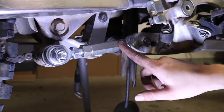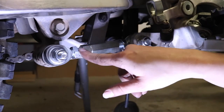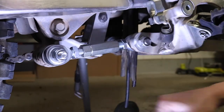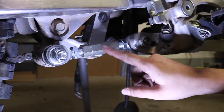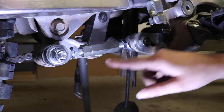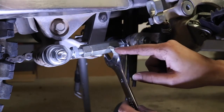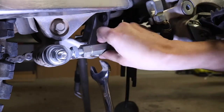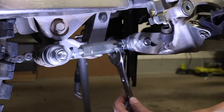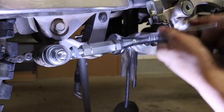What I've done here is loosened up these bolts — these usually go right on this to keep it from moving. I've done the same thing on the other side. It's very important that you keep them the same. What I do is count the flats here and make sure I do the same amount on the other side, so you can keep the same number of turns.